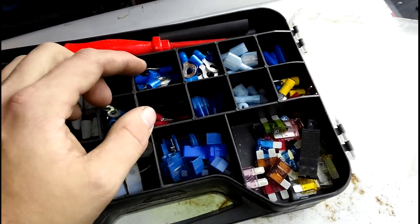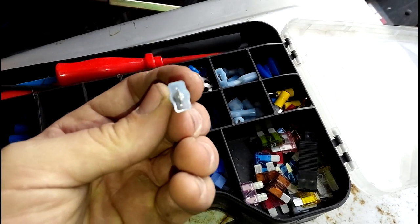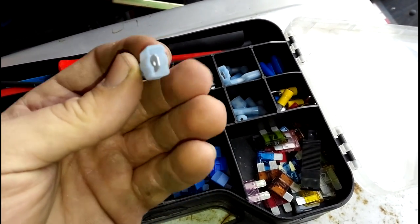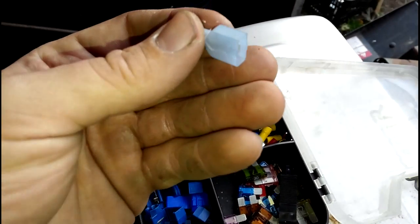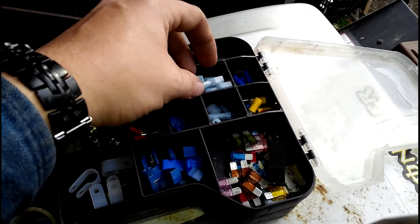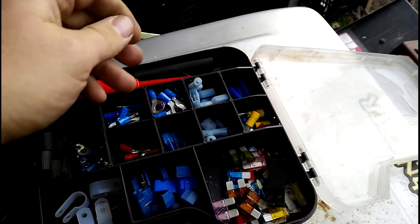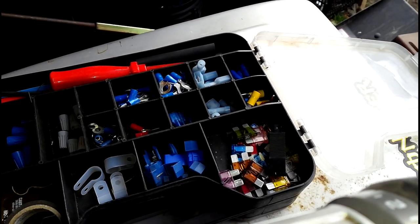Because of the way that I'm doing this mod, you're going to want to have blade or bullet connectors — two male and two female. It's always best to have insulated ones, especially if it's going to be in a wet location. But you don't have to have that if you're hard wiring it in. It's a good idea so that if you're removing your solenoid box, you don't have that extra switch tethered down to it.